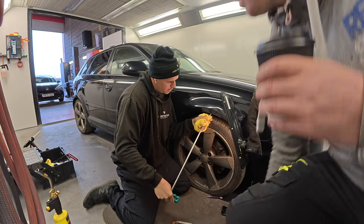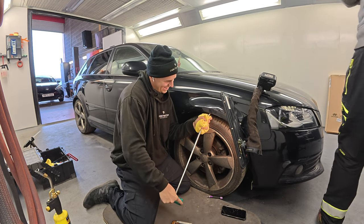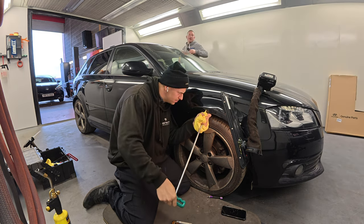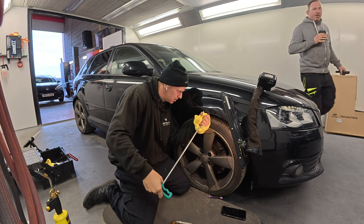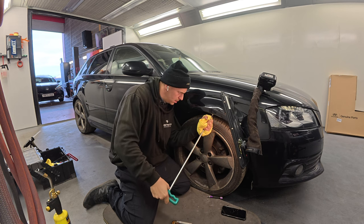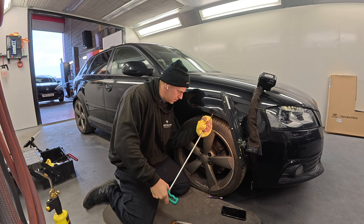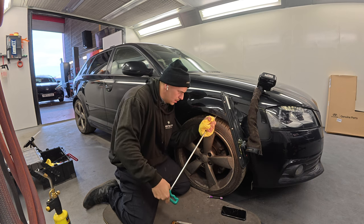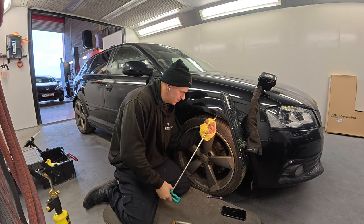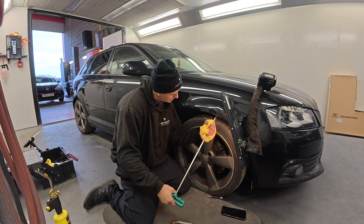Do you get bored of using your machine now? Yeah. It's rock at the minute. Is it? Yeah, I've ordered parts, I just need to strip it down and repair it. What's up with it? Water circuit always says it's empty, it loses pressure, basically a valve in it. Alright. And I rang them up to repair it and they wanted £245. Let me just Google it, got the parts and then I got parts off them. They reluctantly agreed to supply them for £7.95. Ah, right. Hence why I'm doing it myself. Yeah.